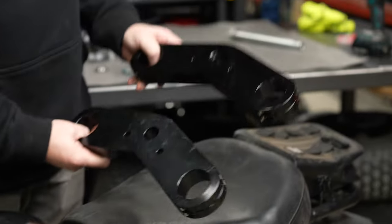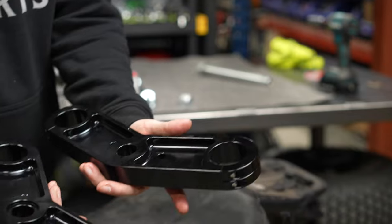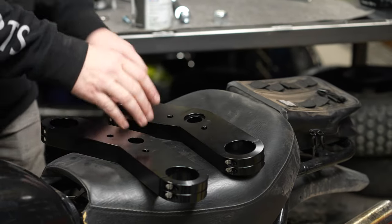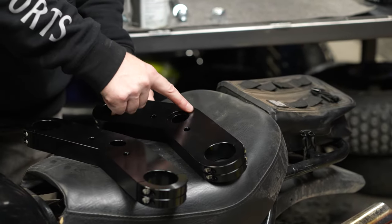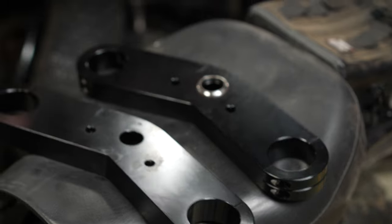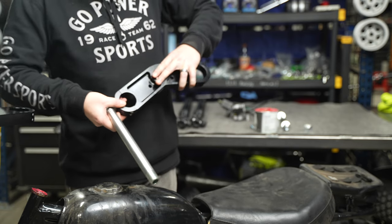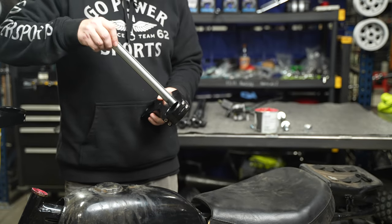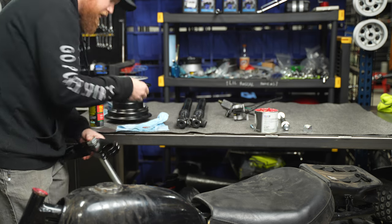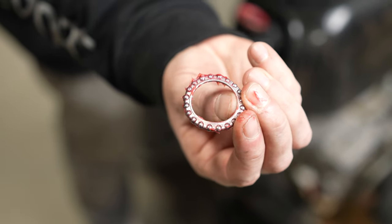If you look at these billet triples, there is a top and a bottom. The bottom of each is machined out to save weight; your top one is just going to be flat. The bottom one is going to have the recess for your race. Put one race in there — this is the top triple, I have it flipped upside down. Put your neck bolt in, then go ahead and put this bearing in the top — the flatter side is going to go down.